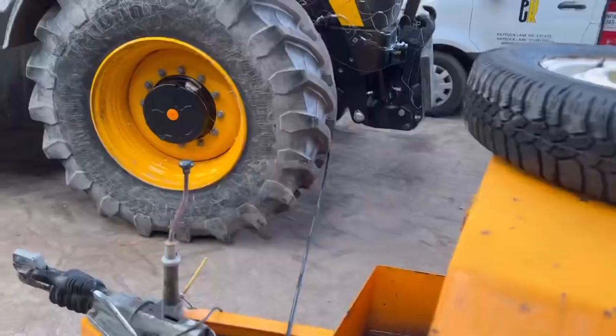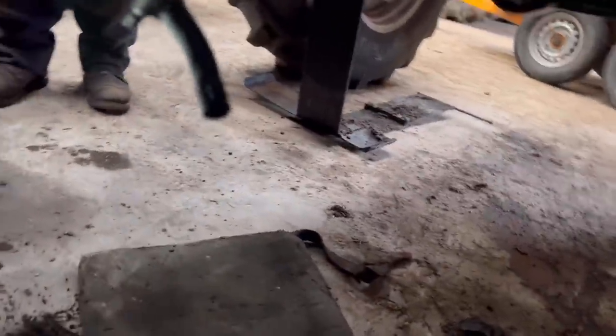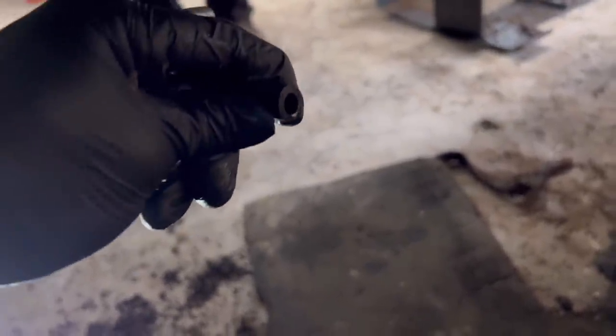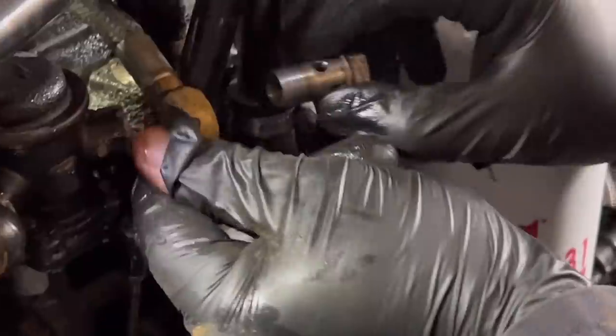So the airline on the front — Rob's just going to blow down the suction pipe now and then we're going to see if anything comes out before we put it back on. Is that blowing? No. Must be blocked solid. Just a little bit now... nothing proper, just a dribble. We're going to take the lift pump off and check there's no gauze in it, check the banjos first. No rubbish in them. We should have blown back down that now.